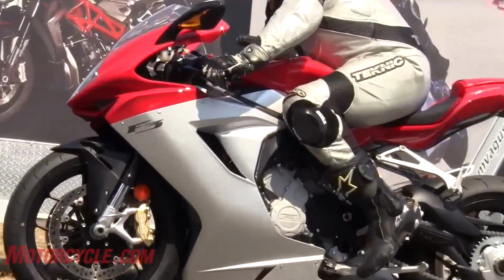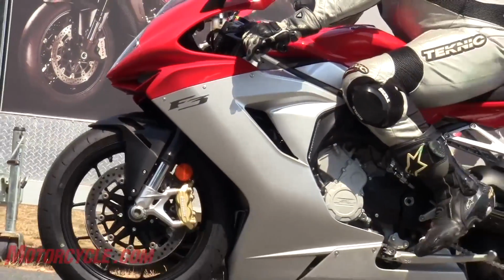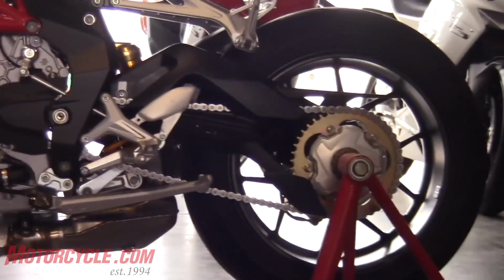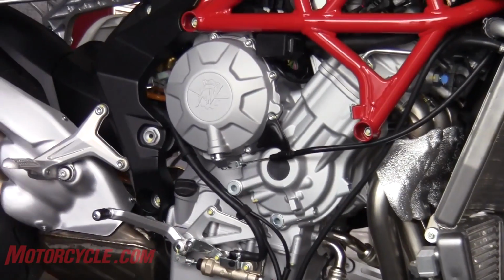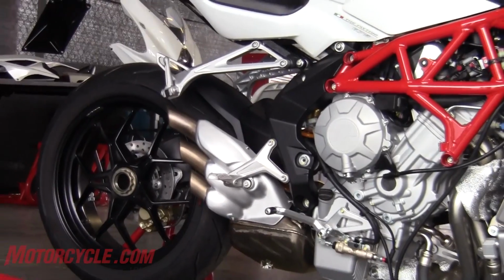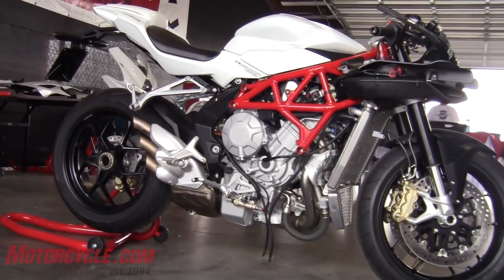The engine is a 675 3-cylinder, revs up to 15,000 RPM, makes 129 horsepower at the crankshaft, homologated with catalytic converter, and drive-by-wire control. This is the only bike in the super sport category that has drive-by-wire throttle body. You can have extremely advanced traction control because you're not just intervening on spark advance to try to get the back tire under control. You can actually control the throttle, so you can control the torque. Basically, World Superbike spec traction control in a 675 street legal super sport bike.